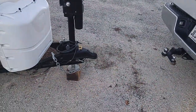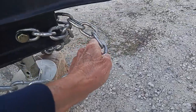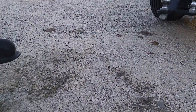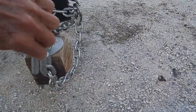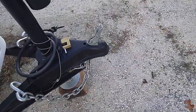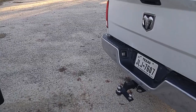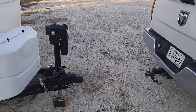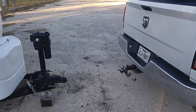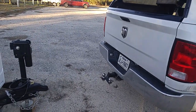Once you get everything hooked up on the ball, hook up the safety chains — you crisscross them. This chain is from the other side; hook it on the right side, the other one on the left. You don't have to let them hang down real low — you can twist each one about three turns and it lifts it up a bit. You just don't want it dragging on the ground or where it could catch something on the highway. To check the trailer electrical — tail lights and so forth — just hit the emergency flashers, because that checks the blinkers, stop lights, and everything in one shot. Walk around, be sure you've got lights.